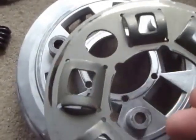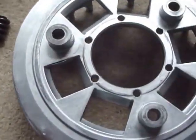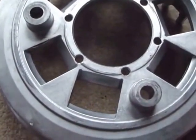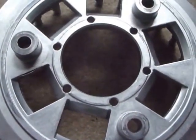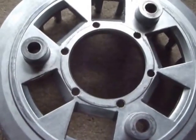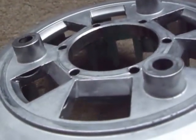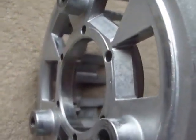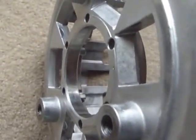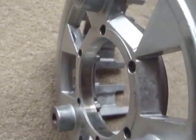So that's quite substantial and that's the problem. Because the basket suffers with that extra vibration at certain periods of its life — we only feel it at 2,800 to 3,800 RPM — but of course it's going off all the time, and what happens is it wears the bearing in the middle prematurely. It's quite a poor bearing — just a piece of not well-machined aluminium as it was cast, running on the hub of the gear there.